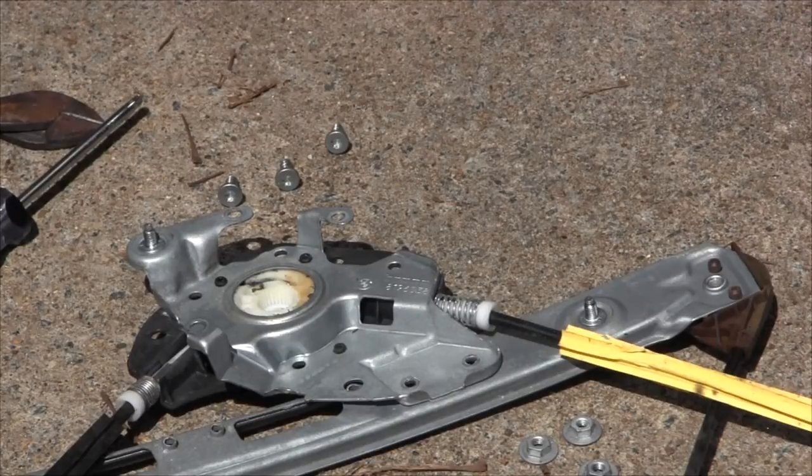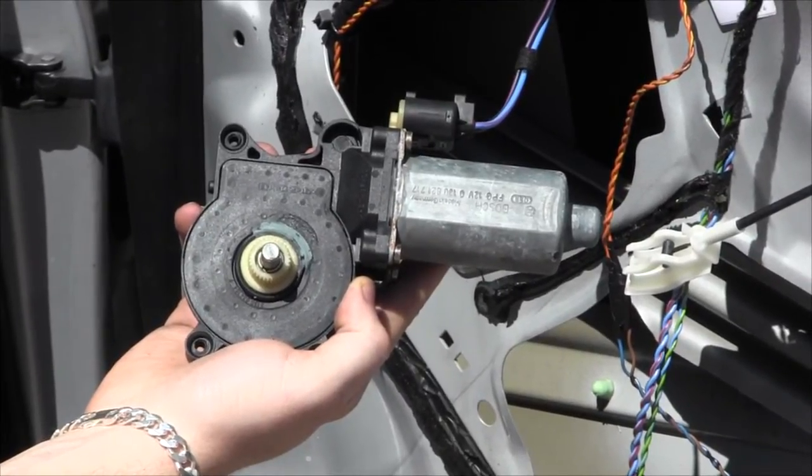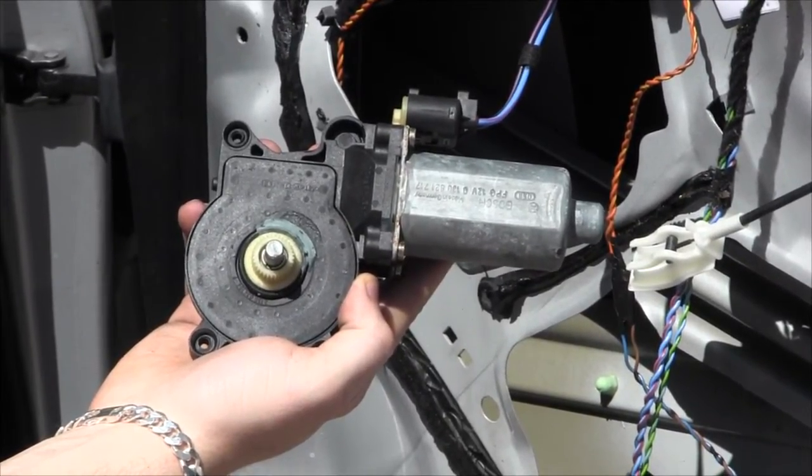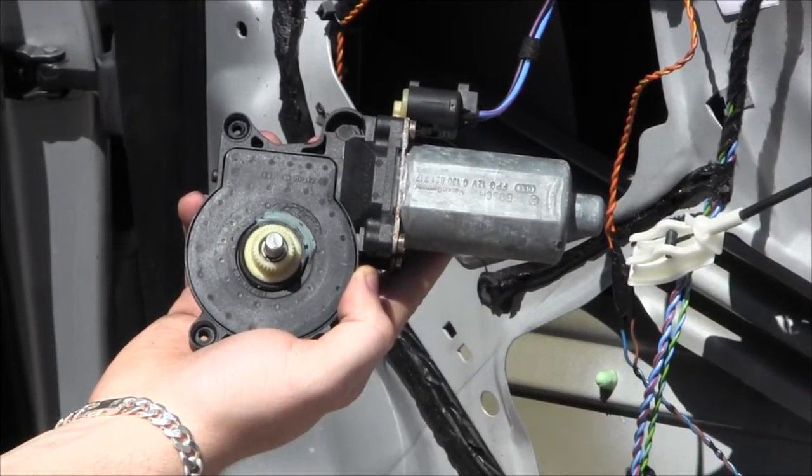messed up. So the next thing we're gonna do, now that we know this regulator is bad, we're going to replace it. And we're going to go ahead and cut it open and see if we can see what's wrong with it. One other simple test we're going to do now that we've pulled that motor off, we're going to actually test, make sure it seems to be spinning free of any labor or anything like that, or making any noise. So we've plugged it back in.